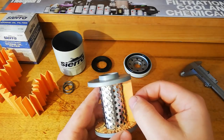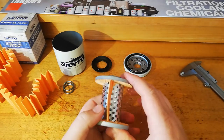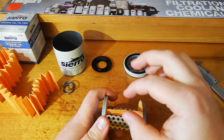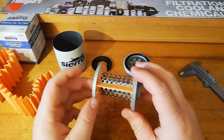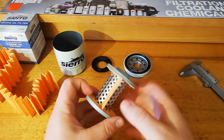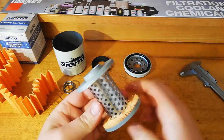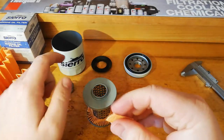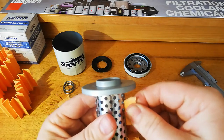Even on ones like this where they're nicely glued, they just move a little bit. Some people like Caterpillar, they actually wrap around the outside of the filter element and glue them to each one to stop it moving. If you're there like Donaldson Fleetguard, you get some with glue around the outside or just other straps to stop them moving and flexing so much. But if you see these holes, I'm just going to tear that in half. Now imagine that moving back and forth like that